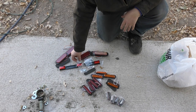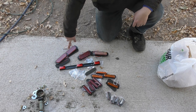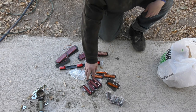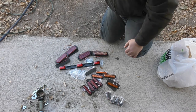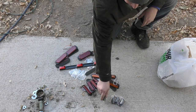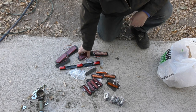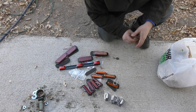You should be able to see down here. We got a bunch of different lights. Of course, got two taillights for each side. We got the center three-light that's required when you have a trailer or a vehicle over a certain width. Then we'll have some side running lights — two on the side behind the wheels and then two of the orange ones in front of the wheels. Then we got a couple of these license plate lights that hopefully we'll have mounted on with the fenders. They're just a simple setup — just got to drill some holes to run everything in and we should be set.